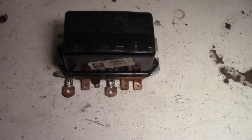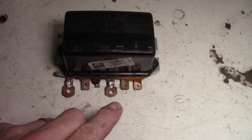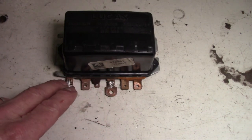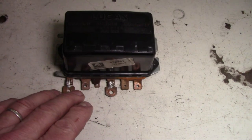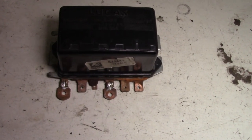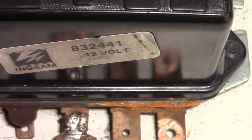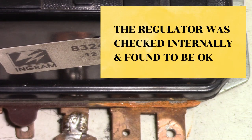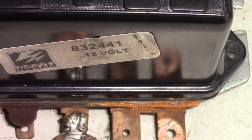Before I connect this regulator I'm going to have a really good visual look over and just check and see what I find on the exterior. You can see that there's been some soldering done here — that was by the customer himself. He stated that it was easier to bolt things on rather than try and find terminals. Soldering looks like it's in good condition. But have a closer look down there on the right hand bottom terminal — can you see what I see? A lot of rust. Maybe this seal has popped out and it's got water in behind it. That'll be one thing to check if the regulator is not working properly — I'll pop the cover off. I want to test it before I pop the cover off and then afterwards to see what's happening inside.